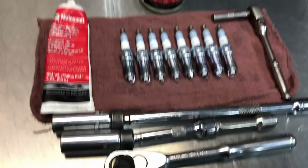We're going to show you how to change the spark plug on the easiest one to get to so you have a clear view of all procedures, then you simply repeat on the others. We're demonstrating on cylinder number one, passenger front, just for video purposes — you can start on any cylinder you want. It is best to go in order so you don't mix anything up. Note that the back two cylinders need a shorter extension, while the front ones work better with a longer one.